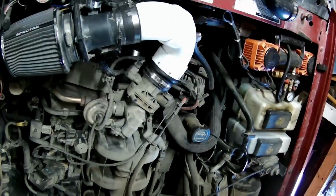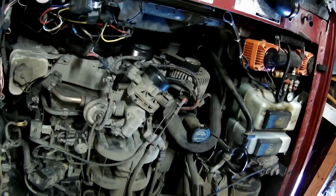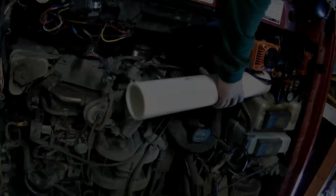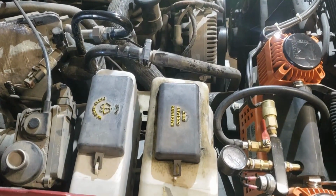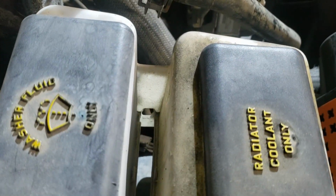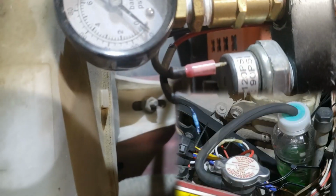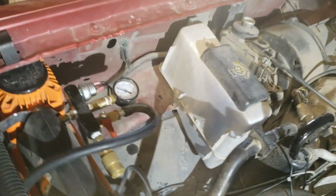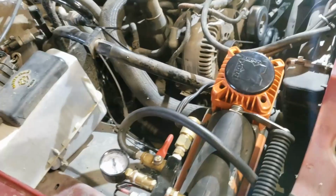After a couple attempts, I realized this gap was too small to work with. Try number 2, failure. But I will not be deterred. This coolant overflow tank is not pressurized, so it could be placed anywhere. Or replaced by, say, an Arnold Palmer bottle. A couple cuts to separate the coolant tank from the washer fluid tank and a couple bolts, and we have a nice open fender to work with.